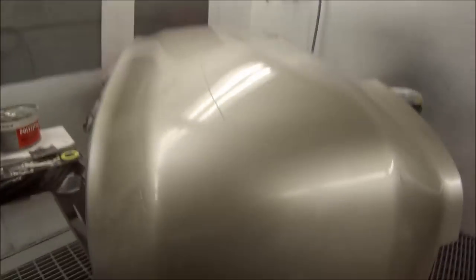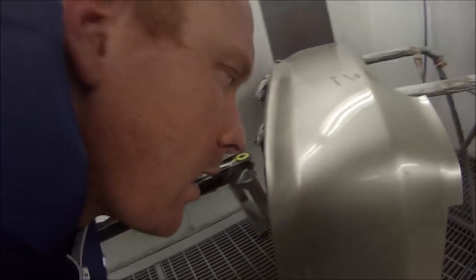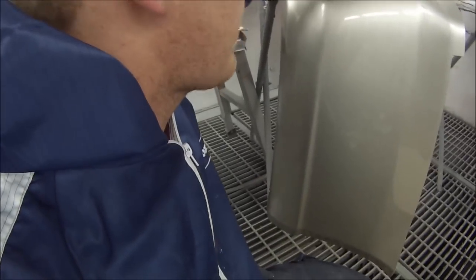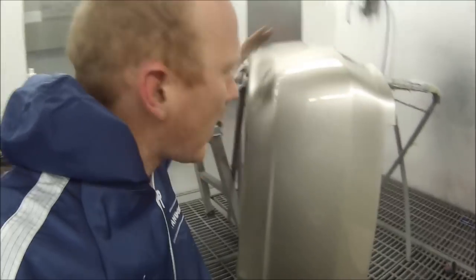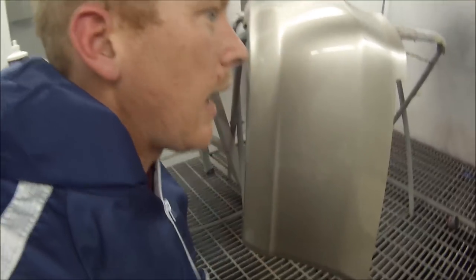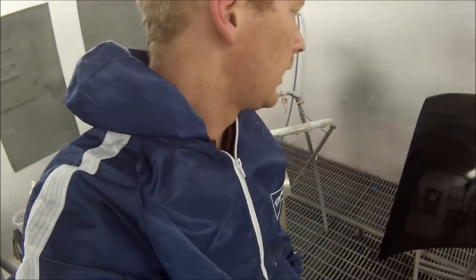Once this clear is dry, we can grab our buff and blend those two areas together and you'll never be able to see the difference. If you want to make that edge look better, put some thinners over it to help melt it in, since we're not painting the whole panel. As far as this job goes, you're not going to get it looking much better than that short of painting the full panel, but you'll be able to buff it out a bit better. I hope you've learned a couple of things from this video — any questions I'll do my best to answer. Thanks for watching, this has been another Gunman Production. Goodbye.